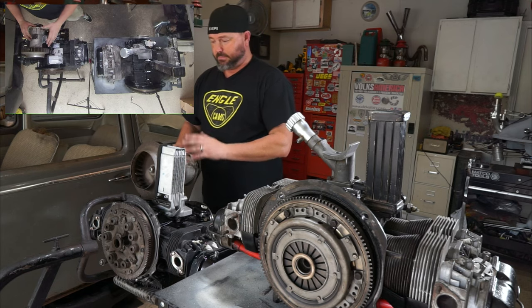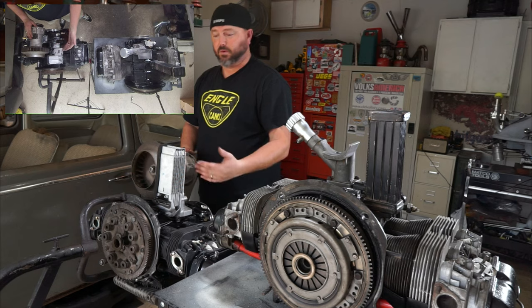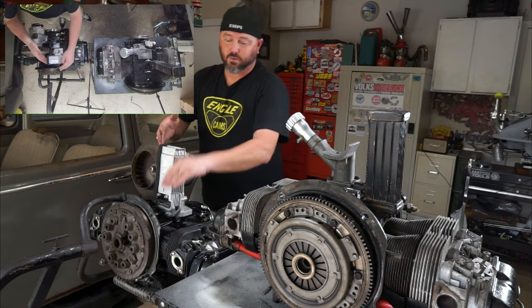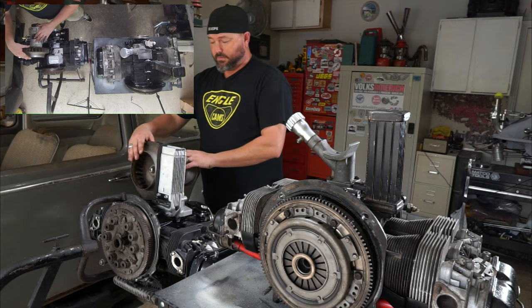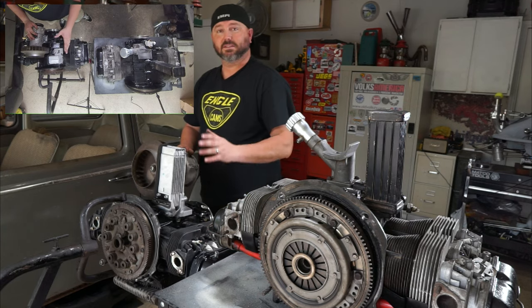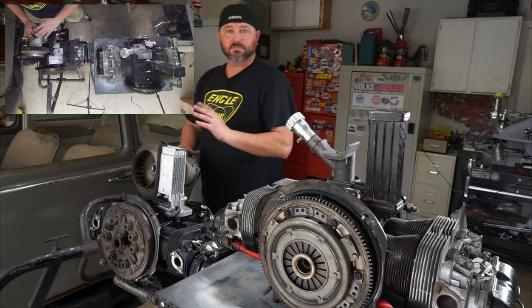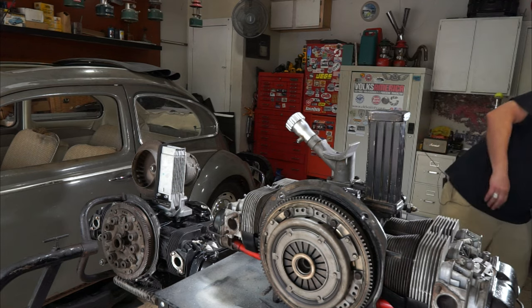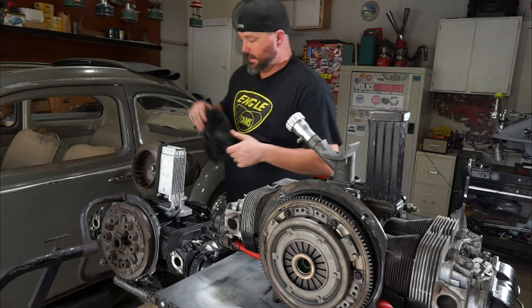You want the coolest, freshest air possible. The later models had this doghouse setup — the air flows past the cooler, and then extra shrouding on the back takes some air and blows it across the cooler, dumping it out on top of the transmission area to get sucked out by the passing wind while driving. That's a huge difference — you're no longer blowing hot air across the heads on the three-four side. Now fresh air comes in: half blows through the shroud and down across the heads, and half blows through the cooler.